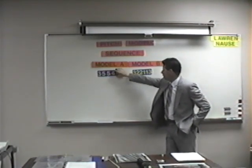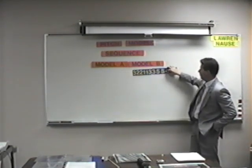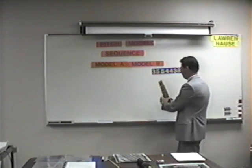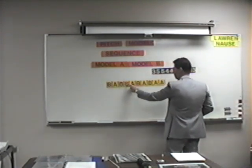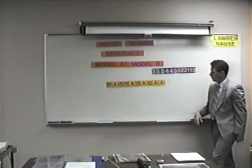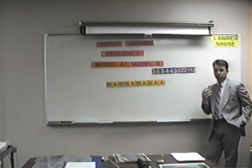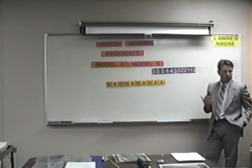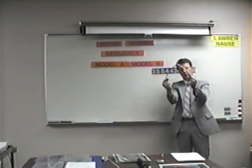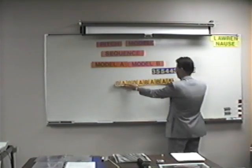Okay? Now, if we put these models together, we've got 2 5s, 2 4s, 2 3s, 2 2s, 2 1s. Then we bring model A over here, we've got the 2 3s, 2 5s, and that often happens. And we just link the models together. So this is what you get: model B, A, B, B, A, B, A, B, A, A. That's a sequence from a tire. Notice they put two B's together, two A's together. Couldn't tell you why, but they did that. I know the reason was for noise treatment, and maybe cost, and factors like that. You take all these models and wrap them around in a circle, and you've got a tire, you see. They all fit together. These two A's match up with the B. So that's what it looks like.